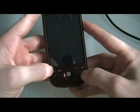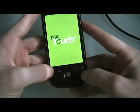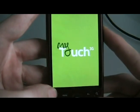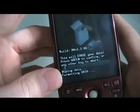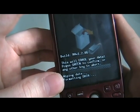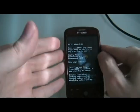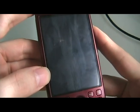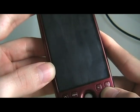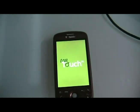Put the SD card into your G1 or MyTouch, then boot the phone by holding down Home and Power. Once you're on the recovery image, wipe again, and then apply update.zip and let that install. Once it's done installing, it should say 'Install from SD card complete.' Click Reboot. If your phone doesn't reboot automatically, hold down Power to turn it on. Once it turns on, you should have your custom ROM running and ready to go.